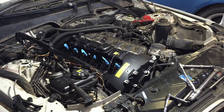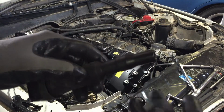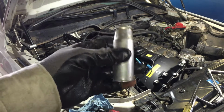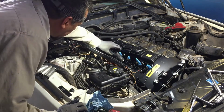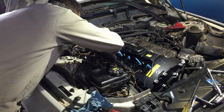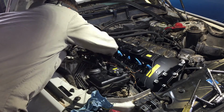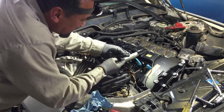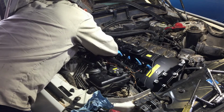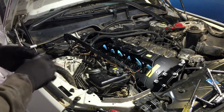All right, the compressor's running, so you can't hear me, but I'm gonna hit these coils with compressed air. I just noticed they were wet with oil, so I'm gonna dry them out. Okay, now I'm inserting these coil sleeves. You just slide them in there, and they'll hit and stop. I look at how they come out, which way that little cut is. I don't think it matters, but I'm doing it the way they came out. Okay, and then now I think we can start with the coils.